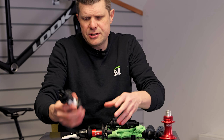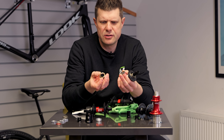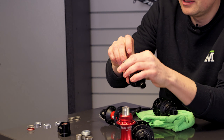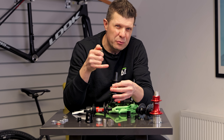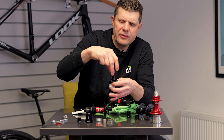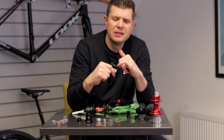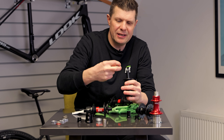This is the 350 — probably the legendary hub that most of you are most familiar with. Those are the two ratchet drives — this one's actually been used a fair bit in a wheel. These are the bits you're now starting to see in all these Chinese wheels. That aluminium spacer is significantly wider, and the bearing here is actually behind this ring, so home mechanics will really really struggle with this. Here in the workshop we use a tool by Elevation Wheel Company and a big impact driver and that just hauls it out quickly. That is probably the biggest criticism of the DT hub system — access to that bearing. It's really well hidden with a big steel washer over the top, and it's quite hard to get dirt all the way in there, but it can happen.